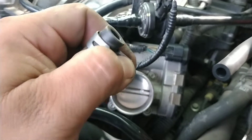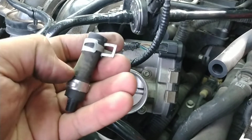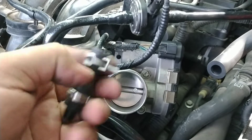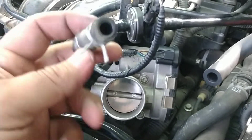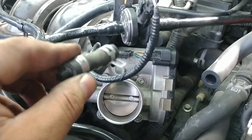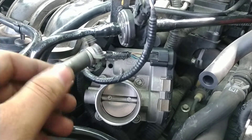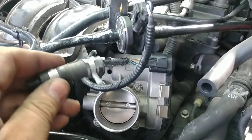These hoses are pretty soft, so I just squished it with my finger, moved the clamp as far back as I could. This thing is on there tight — with time these things get tighter and dried up on there. Once I had the hose cut and the clamp moved back, all I did was spin the hose.